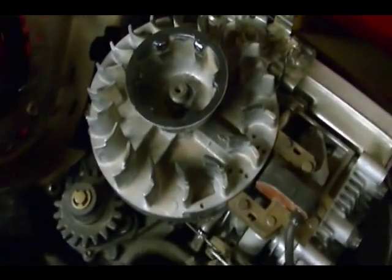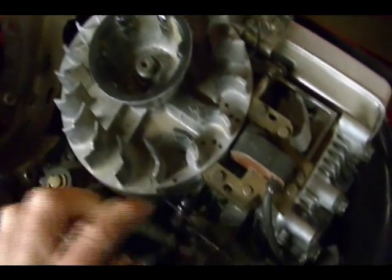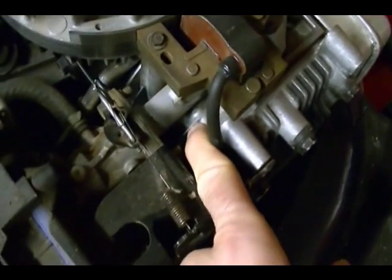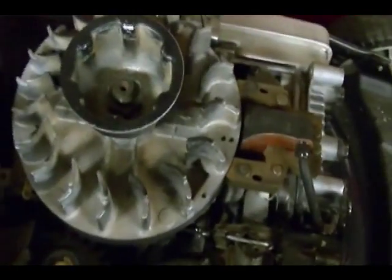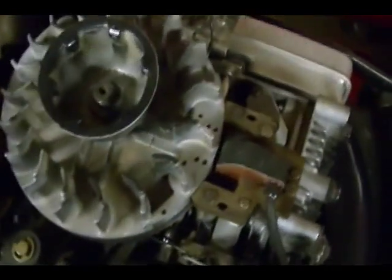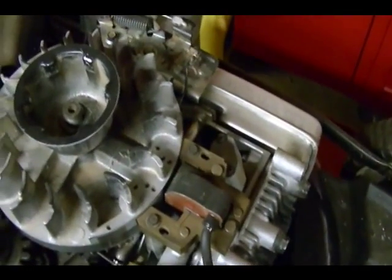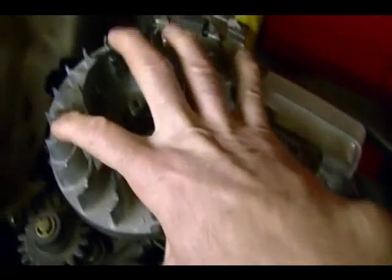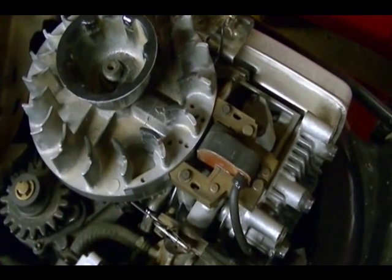With the shroud off, you can see the fins on the flywheel. These fins draw air into the engine and help circulate it through all these passages and around the cooling fins on the cylinder. You need to make sure all this area around here is clean. The best way to do that is with compressed air, if you have it. If you don't have compressed air, you can use a screwdriver to dig things out and pick it out of the engine. Sometimes a paintbrush will help. Just make sure that this entire area is clean so that there are no blocked passages and the air can flow freely around the engine.